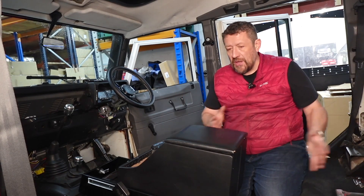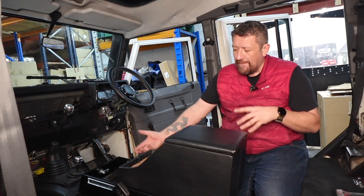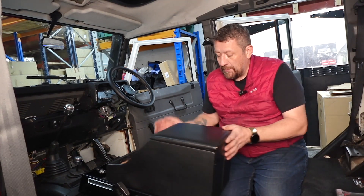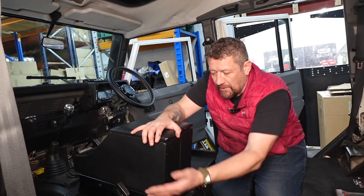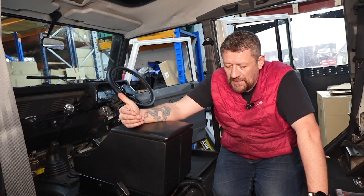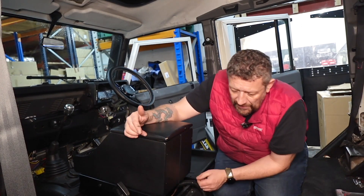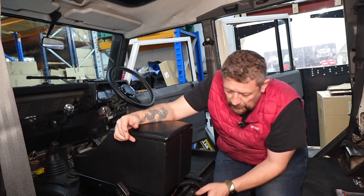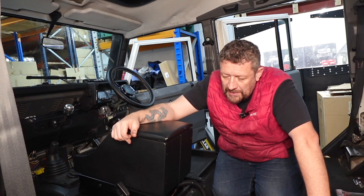But because it's sliding, the wires are all going to get tangled up. All the wires for the stereo and everything are fed from there. There's already an aperture at the back so I can pull the wires out, and there's a feed — I've got a harness going through. So it makes perfect sense to just join things onto that harness itself. We are getting a bit chunky on the harnesses, so I'm just wondering whether moving forward we might want to reroute that somehow, actually underneath and into that battery box.